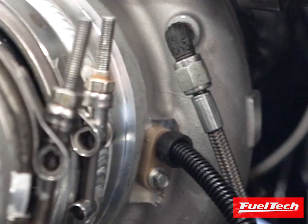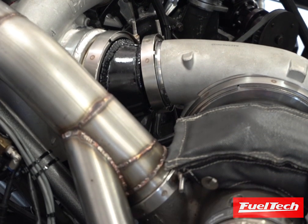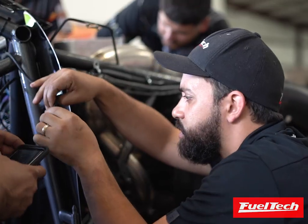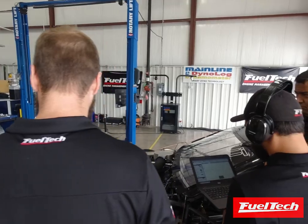One of the most important sensors on a compound turbo system is the turbo speed sensor. With the turbo speed sensor, you're able to know exactly what RPM the turbo is turning. Without a turbo speed sensor, you may be guessing — trying to increase the effort of one turbo or the other, but never really sure where you are on the compressor map. Any FuelTech ECU from the FT-450, 500, 550, or 600 can be connected directly to record both turbo speeds so you can see them in the data logger.